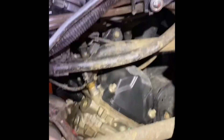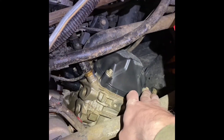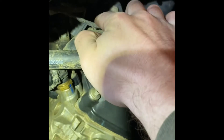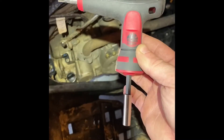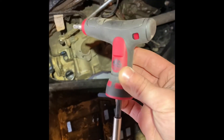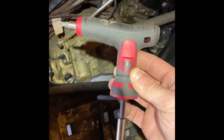You take the side plastic piece off, then you get into it where there's four valve covers. The other one's back in here, and there's one in the front right there. To get those off I'm using a little torque driver with a T30 on it. They were pretty easy to break loose, then you can just screw them out by hand.